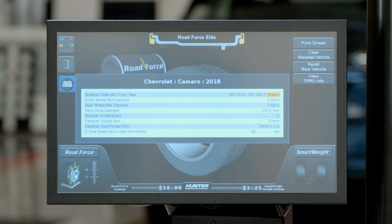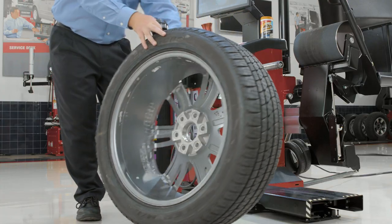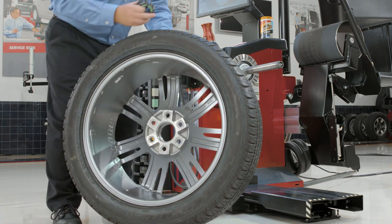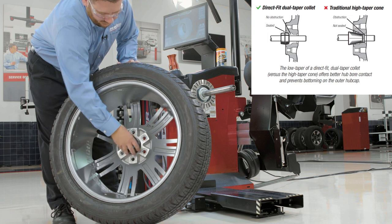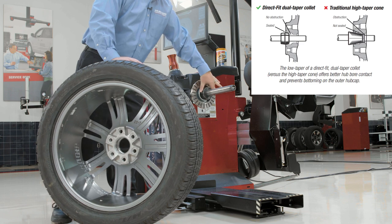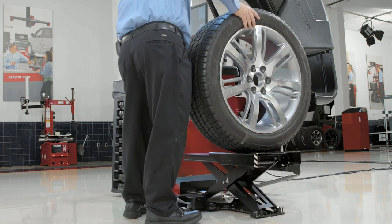In this case, the vehicle that we're using today is not listed in our database. So what we'll do is go ahead and select a collet from our kit down below, and then we can take that to our tire and wheel assembly. This one doesn't quite fit, so we'll go back and grab the next size up. When selecting a collet, we should be mindful to select one with a taper that's going to fit the inner bore of the wheel without bottoming out on either the collet or any internal features within the wheel. This is an important step that is commonly missed, and if missed, could result in improper mounting and improper balance.